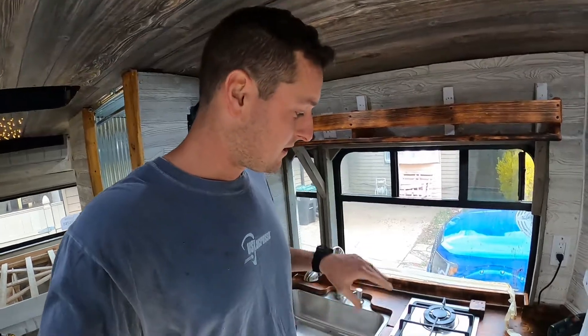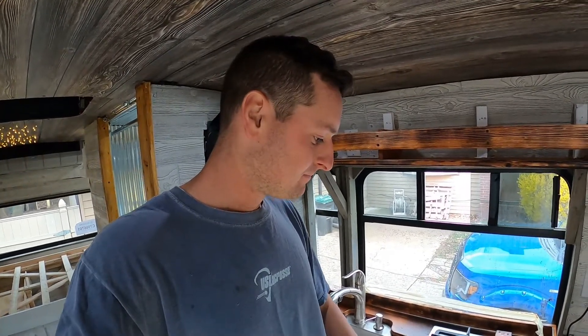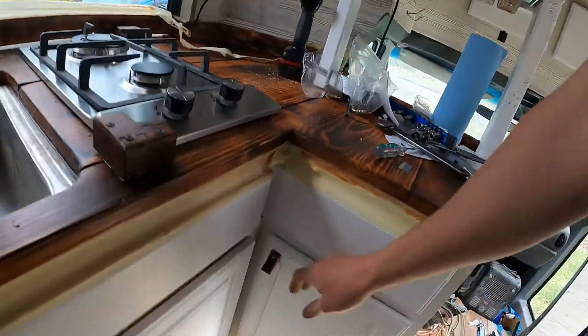After a lot of unnecessary attempts to make this stovetop work, pretty much all I needed was a regulator on the propane tank — it's adjustable, so I had to find the right pressure — and then this thing works happy as can be.